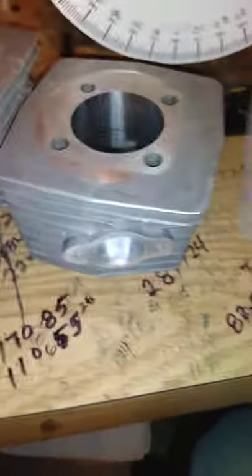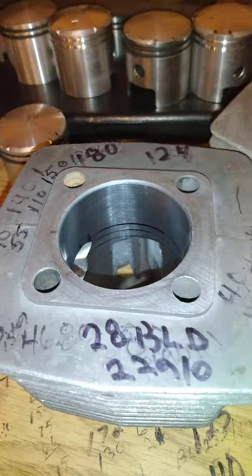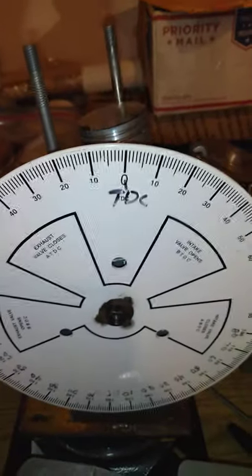A rounded radius roof is going to give you good mid-range power — a lot safer. I've got all kinds of shapes, all kinds of boost ports — narrow, thick — but all my boost ports are at a 25 degree angle. A jacked cylinder and deck is going to be better than a ramp because my flame front travels best with a stock piston. I can achieve my desired port timing by lifting the cylinder. Like I said, you can lift it three ways: lift the cylinder, ramp the piston, or port the transfers. You've got to choose what you want and how you want your motor to run.